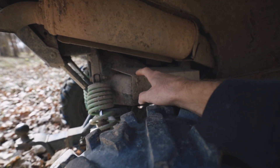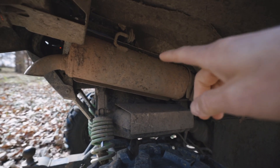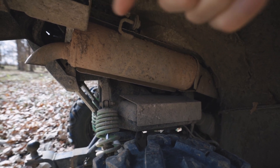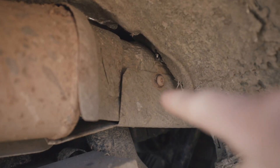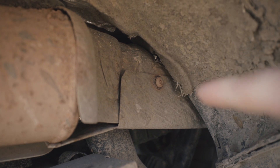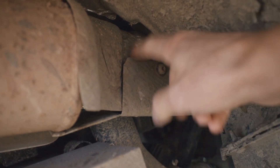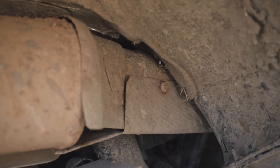Another big thing is the heat shield on the exhaust — these will rattle sometimes. That's just from the aluminum plate wearing out around the little screws that attach it to the muffler. What you can do is put a new washer on the little screws that hold this aluminum plate, because sometimes it'll wear out the aluminum after so many miles. Go around and check those screws, those washers, and those aluminum plates — you may need to put new washers on them.